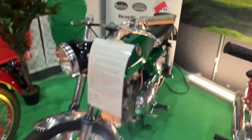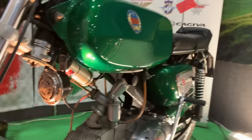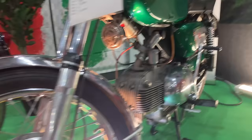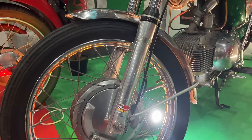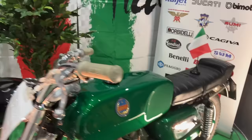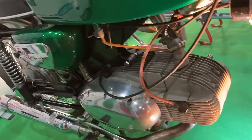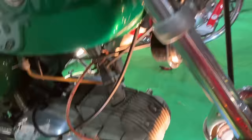The Benelli 250 SS. Founded in Pesaro, Italy in 1911, Benelli is one of the oldest manufacturers of motorcycles in Italy. The Benelli SS, or Sport Special, was produced from 1968, and would feature an engine which would be familiar to Aermacchi lovers everywhere, having a horizontal single-cylinder four-stroke engine of 245cc. There was a bore and stroke of 74 by 57, and a compression ratio of 8.5 to 1. Peak power was claimed at just 12.5 horsepower at 8,500 rpm, enough for Benelli to claim a top speed of just over 80 miles an hour.